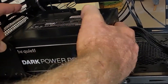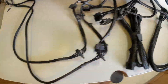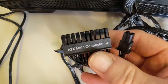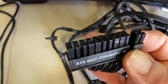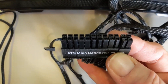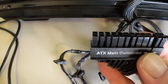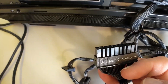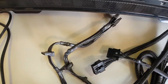The reason we got the semi-modular version of a PSU is so we don't have a bunch of cables in the PSU compartment that weren't being actively used. This is the main cable attached permanently to the PSU — it is referred to as the 24-pin motherboard connector and will go to the right side of the motherboard near the top. Some older boards use 20-pin connectors, so you fold the four pins away. Most folks will need to hook these together to insert into their 24-pin motherboard header.